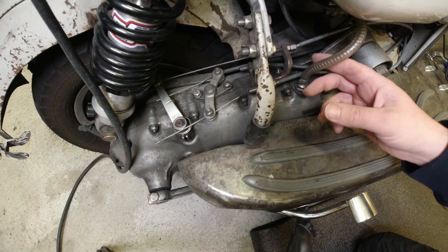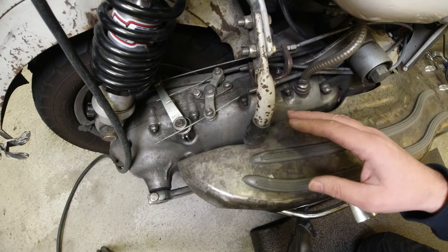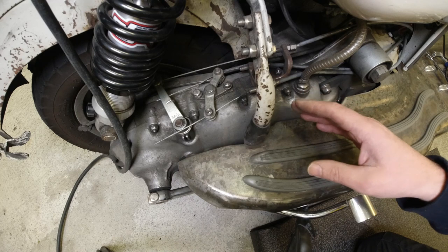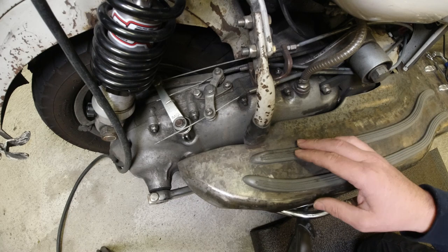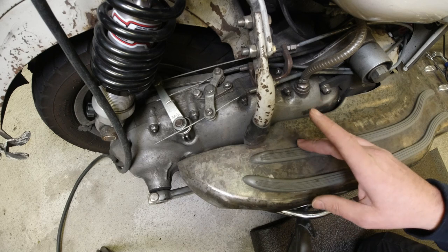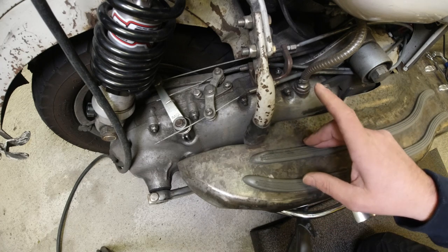The reason for that, I think, is the fact that I've got one of these so-called super clutches. This is the LTH 7-plate clutch. And they don't show problems quite as easily as a standard 4-plate clutch would. Now, if I had a 4-plate clutch and took it a couple of laps around the block, I'd probably feel slippage straight away. And another thing I would notice is that my clutch plates would probably be worn out very, very quickly.